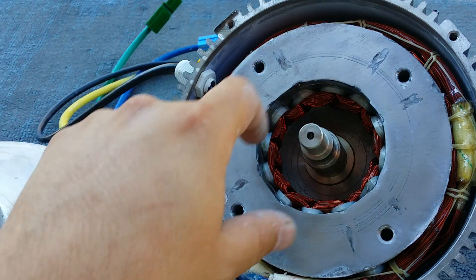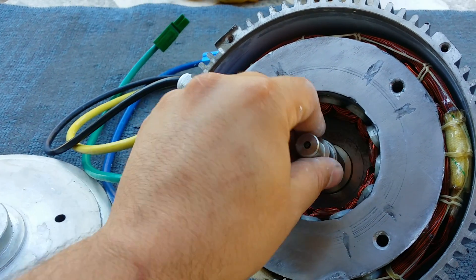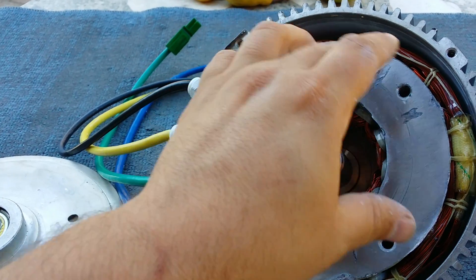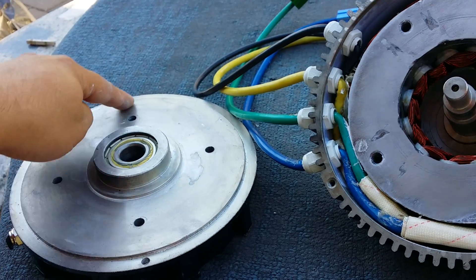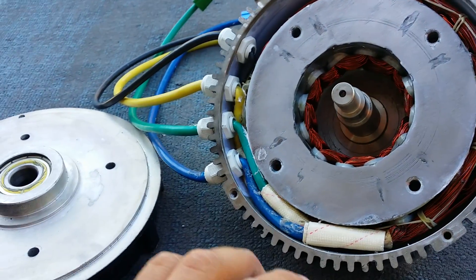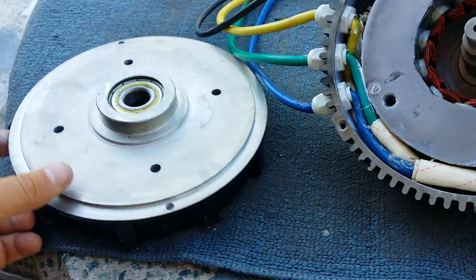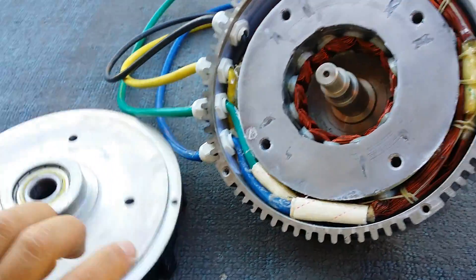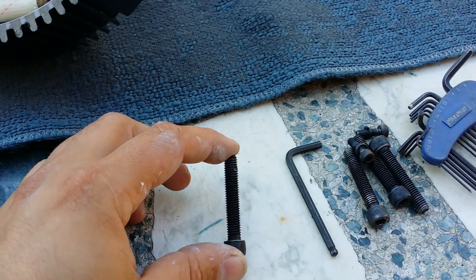These four holes here — this plate not only cools the motor but also aligns the stator so it's perfectly centered and straight, and it's at the correct distance from the magnets. It actually pulls the whole stator out maybe less than a quarter inch. This whole center part is locked in with a lock ring on the other side so it can't come out or move, so it stays perfectly positioned. The magnets grab against the stator, so these screws have to be the perfect distance so they don't bottom out.